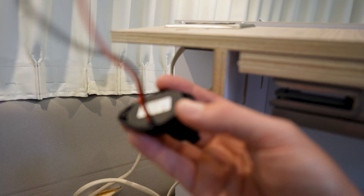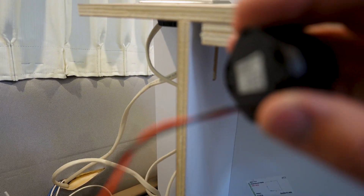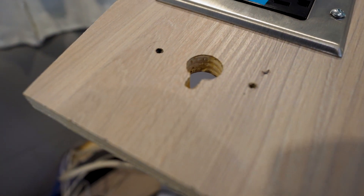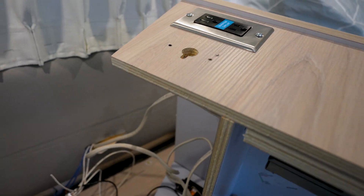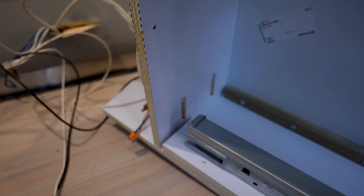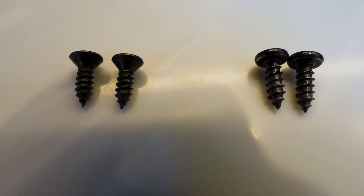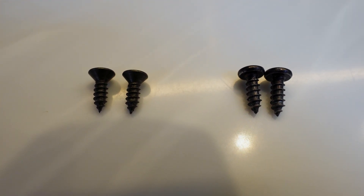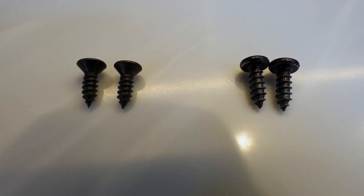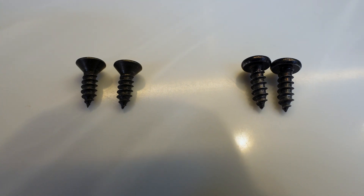One of the reasons I made that hole on the 3D printed part so large is because the wires are offset — they don't come right out the center. There is a cutout with two holes and then one hole, and they come down the side for the same reason, to handle those wires that aren't centered. The next steps are installing the USB port onto this 3D printed L-bracket. Here you can see the countersunk screws on the left that I'll be using for the USB port, and the original Airstream screws on the right. I'll reuse those Airstream screws on the 3D printed part going back into the cabinet. You just need two more little screws like on the left — preferably countersunk, but the standard ones are probably okay too, as Airstream seemed to think.